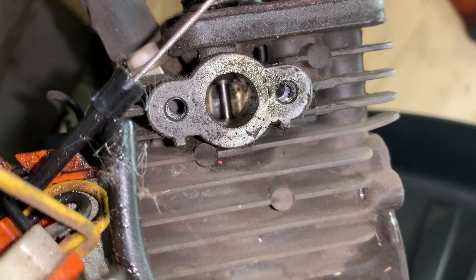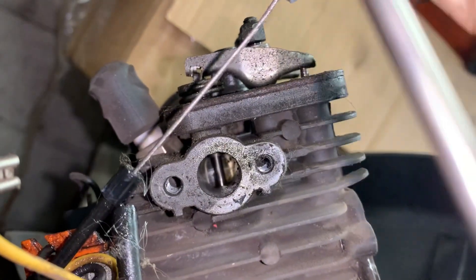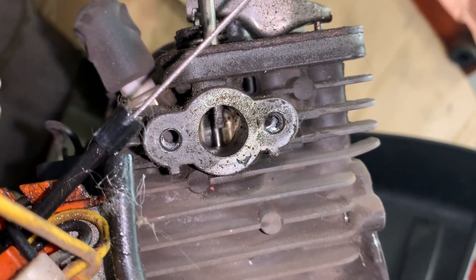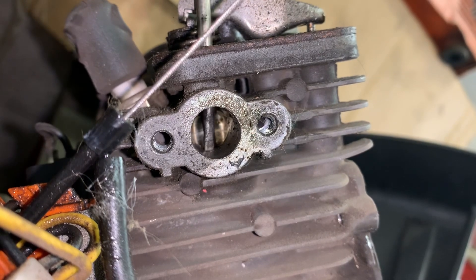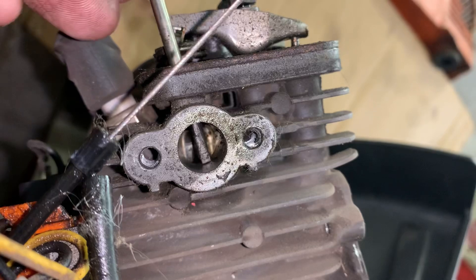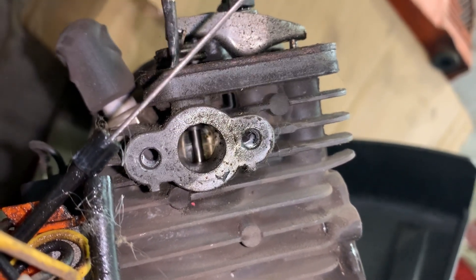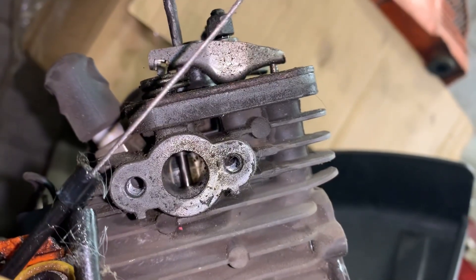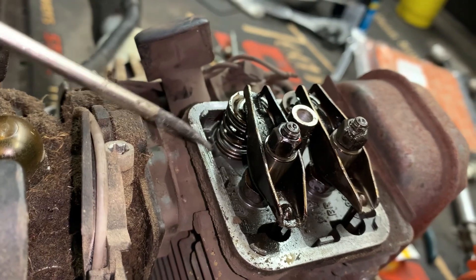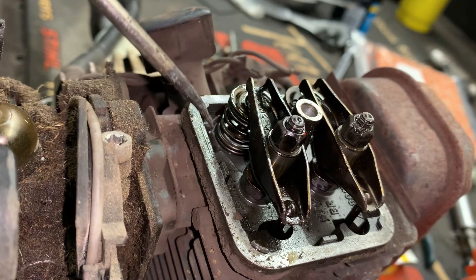This is an FS111 — the more modern four-mix engine. I'm going to take my screwdriver and go right down through this passage, and you can see that we have an open, gaping hole right in the intake stream of this engine. This is where your top end is going to get its fuel mixture. Of course, when the valve is open and the charge goes into the cylinder, you're lubricating the piston rings and cylinder walls.